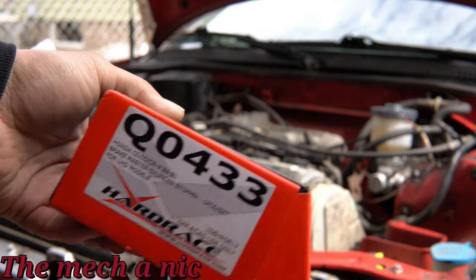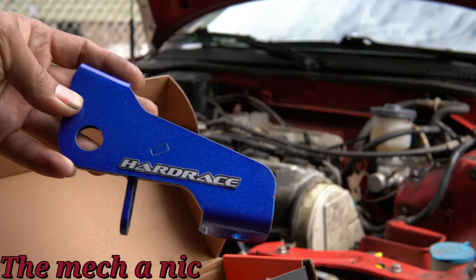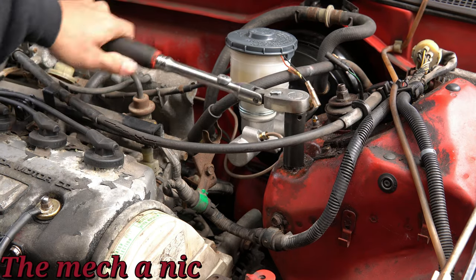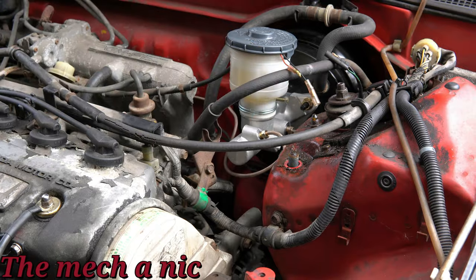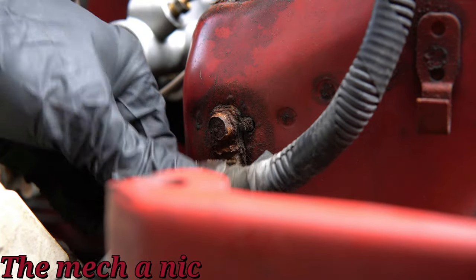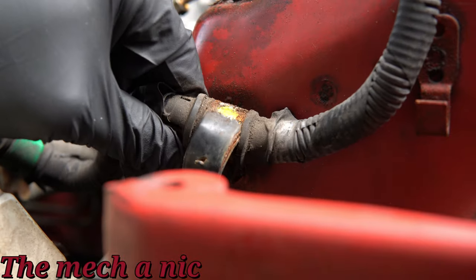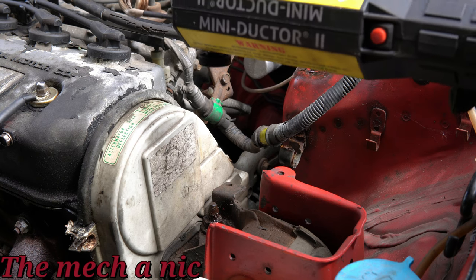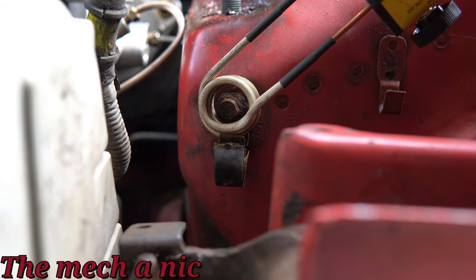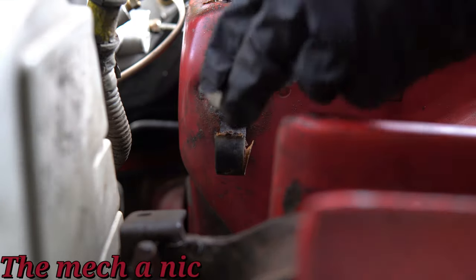Here I have a master cylinder brace that I've had for some time. I just haven't installed it because technically it doesn't fit on my car anymore — I upgraded my master cylinder and brake booster to that of an Integra part, and because of that it no longer fits. There's no space for the plunger, so it looks like I'm gonna have to modify that part in order to fit the car. But first I have to deal with all this rusty crap. This 10 millimeter bolt is pretty much rounded off and rusted in place, so I'm going to use heat on the area and a socket that's made for extracting rounded-off nuts. It worked pretty good — after I tried this method it came out without a problem.